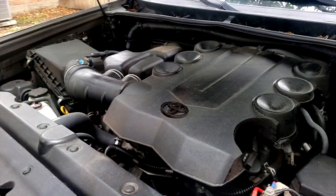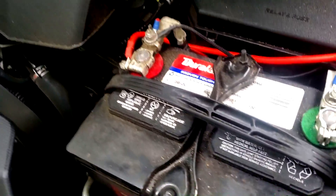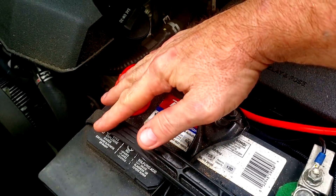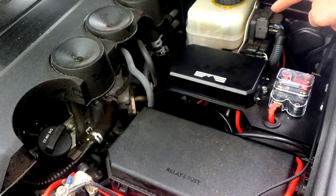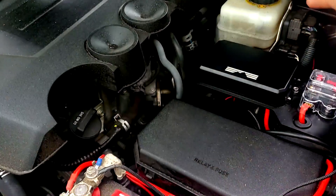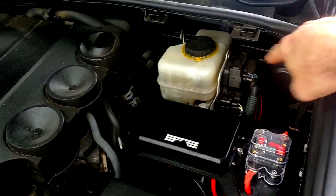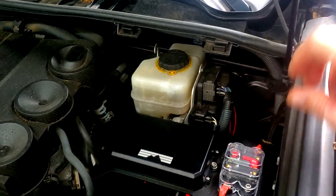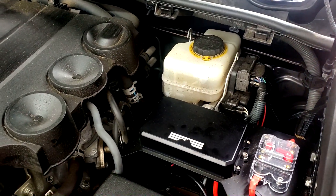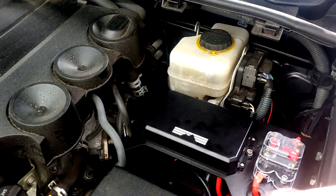This is mainly for Toyotas — you can get them for almost any car, but this one was specifically made for my Toyota. We're going to pop into my engine compartment and I'll show you what I did there. Looking down at my engine compartment, you can see I've got the original wiring for the radio hooked up directly to the battery, going back through the firewall and back in to where the fuses are inside. I had to cut the wires to feed them through the firewall, then re-soldered and crimped everything to get the wires connected again before I ran it back to the radio.